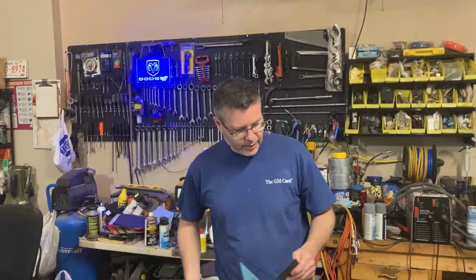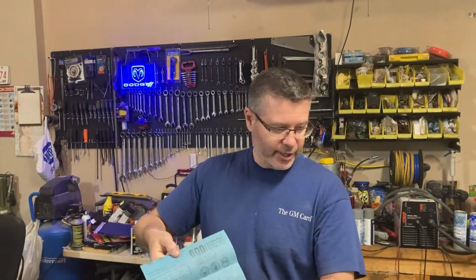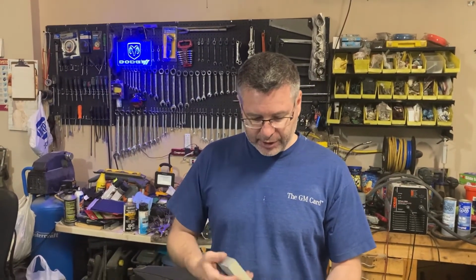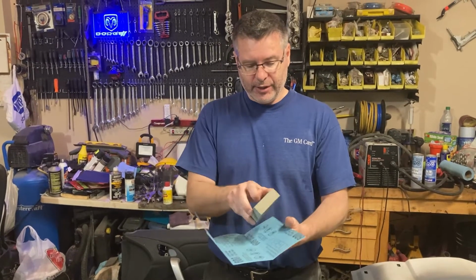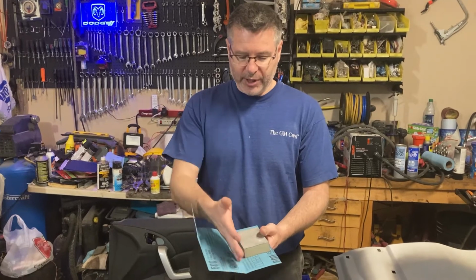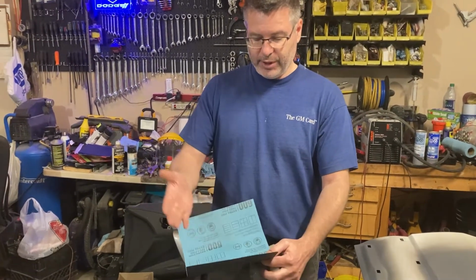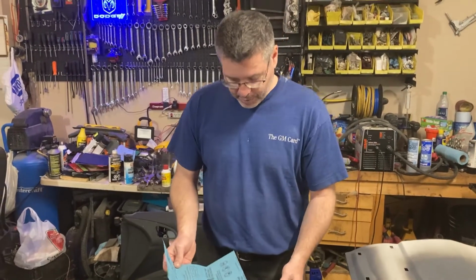Right on. Okay, so I usually buy these bigger sheets. We're gonna move to 600 grit for sanding down the primer. Could do possibly 400 wet, 600 dry. And then I like to fold it into threes, give it a cut, and that'll go onto that block really nice. If you're using a longer board, you might just want to use that whole sheet there. You can also fold it the other way for threes, and it's a little bit longer. But this will work for our purposes.